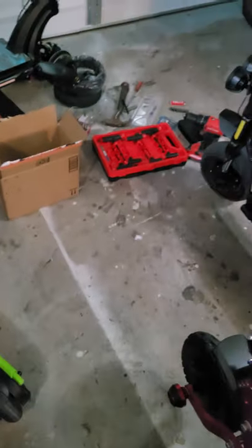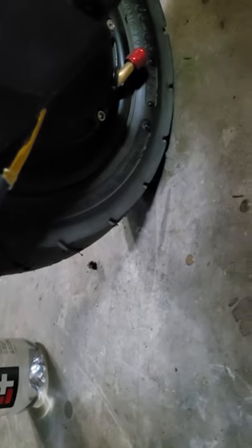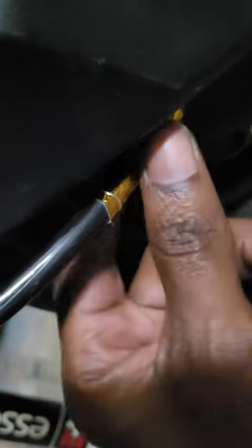And the Wolf — shout out to the guys in the Kaabo Wolf Facebook page, they've been very helpful. A guy said that the wire to his rear motor was chafed and had some cuts after only three weeks of riding. The wire that goes from the motor to the deck had some cuts. So I looked at mine and it definitely had some wear. I guess it's from when you're bouncing — this part of the wire is hitting the swing arm when you're jumping, hitting the hub wire and causing damage.